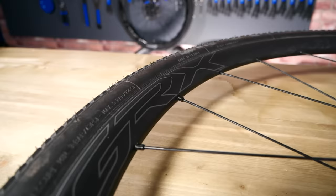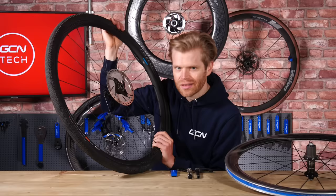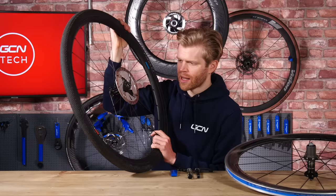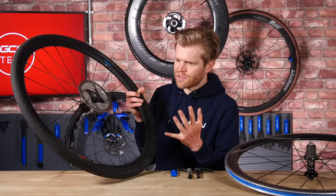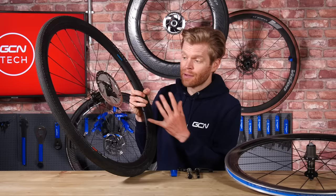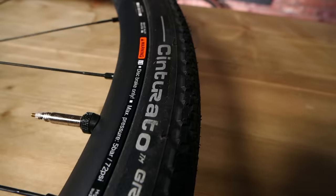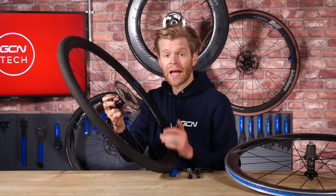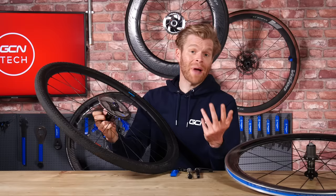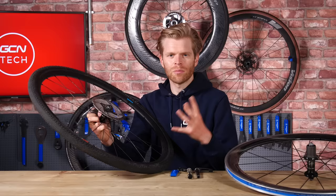At this price, you're typically looking at an alloy rim rather than carbon and quite shallow as well, usually below 30 millimeters in depth. They're likely to be lighter than the entry level wheels that your bike came with, although not by a huge amount. They will also probably be stiffer and better built with higher quality hubs. These aren't going to be the lightest wheels in the world, but they're typically available under two kilograms and won't have the latest tech. Thanks to the way that manufacturers trickle down tech, you are getting features that a few years ago were top of the range. The hubs will typically feature sealed cartridge bearings, although some brands such as Campagnolo and Shimano still use cup and cone bearings, which can be a little trickier to maintain for an amateur mechanic. Also, try to look for a brand that uses parts and replacement bearings that are readily available and accessible.